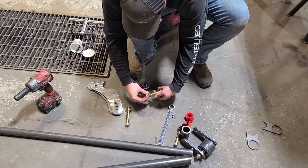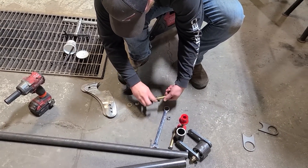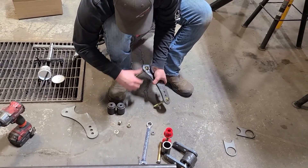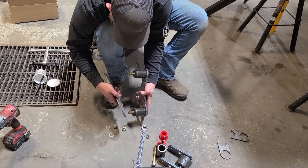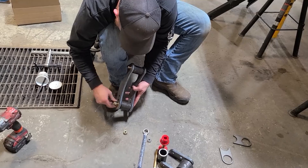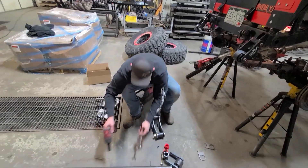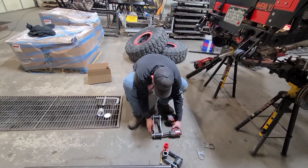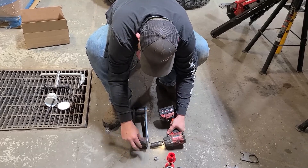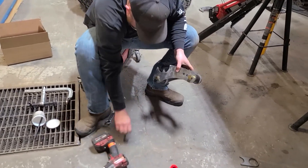Now it'll come with these two 9/16ths bolts. Run your bolts through the holes — I like to use the farthest apart just to ensure you get all the leverage for this kit. Put these back on. Remember, this will just be a mock-up because we're not going to weld them with the bushings in; we're just going to tack everything in place at the moment to get our tubes and everything done. You'll need a 13/16ths socket and a 7/8ths wrench to put these on. Now this piece is ready for mock-up.